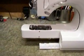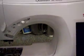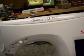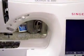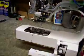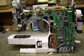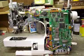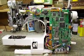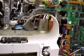As you look at the rest of your machine, you need to take the covers off, and they actually don't come off this simply. They need to be taken off very carefully, and you need to use special attention. There are many wires on the inside front cover that are attached to the main circuit board that need to be taken apart in a very special way, and you need to have a special grounding circuit, and you need to handle these electronics with great care, because there is the chance that you could short out one of the main circuit chips on the machine if you touch something or get oil on the wrong part.